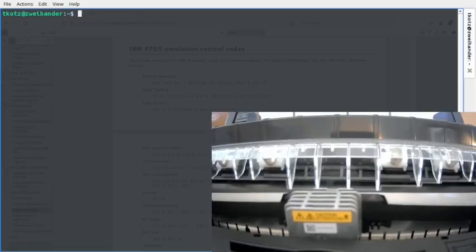But anyway, let's discuss what we've learned here from this printer. So it does support the IBM codes. It does let me change the font. I have another file somewhere with some more detail there. For single sheet paper, a big negative of this printer is that you do have to manually load it a single sheet at a time. It does not support any sort of selecting a single sheet at a time out of the hopper of paper. So that is an important thing to consider.